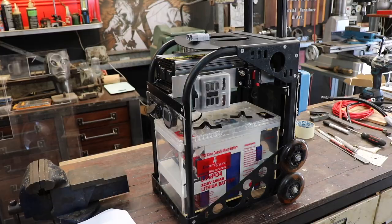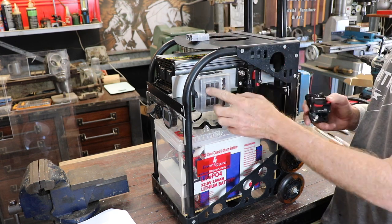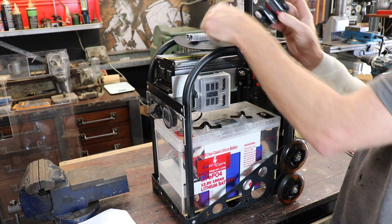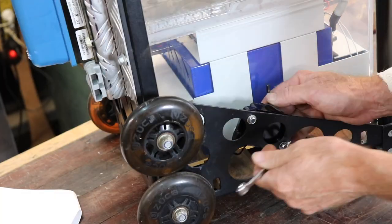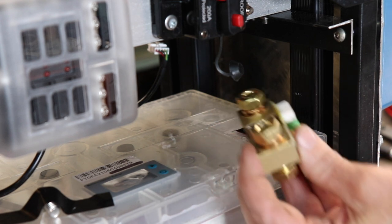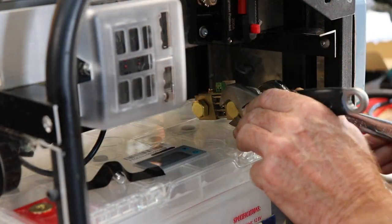Let's wire it up. I've just realized this is going to be my power charging inlet and outlet. The charger I've got is 25 amps, but going through this panel here the maximum fuse rating I can get is only 20 amps. So I'm going to try and find a place for this breaker, which is 50 amps. The plug's rated to 50 amps, the charger's 25, and this breaker's 50. This is the negative terminal of the battery and I need to put a shunt on to measure how much electricity I'm using or putting in. I've got a piece of aluminium — I'm going to drill a hole in it, create a little bracket, and attach the shunt to that.